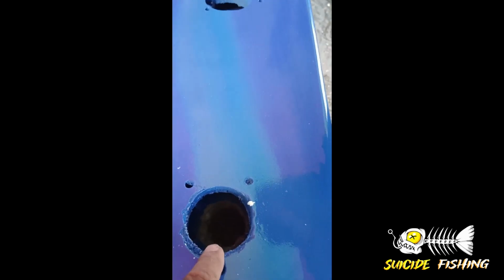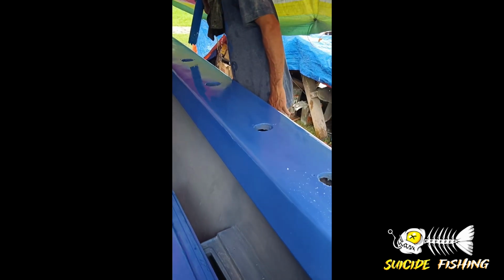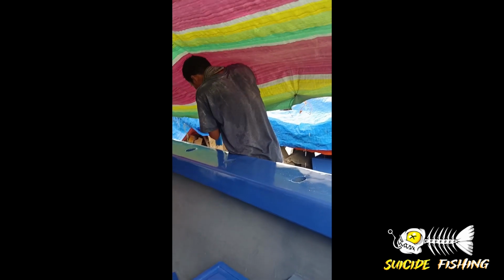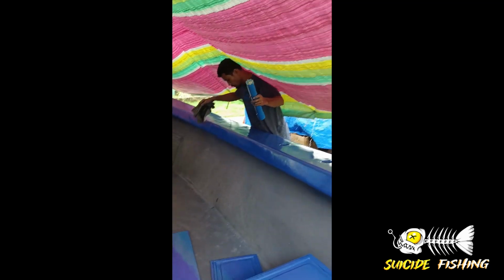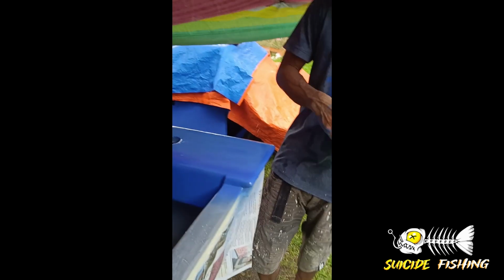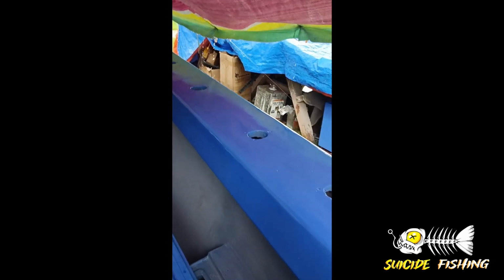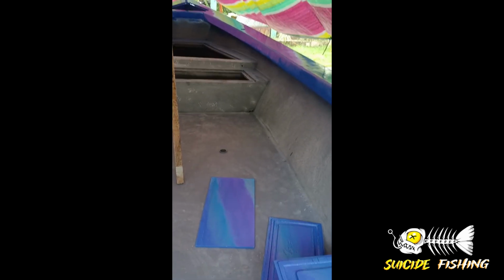This is a 15, and obviously you can see where it's going at an angle. Dennis is angling it at approximately 15. It won't be perfect, but what we can do is we can slide in the fishing rod holder. And what's going to happen is because it's round and tubular, like that PVC, it'll just trim off what's not needed. And then we take a blower and we'll just blow at a height about 6 inches above that, and it will blow out all of that powder and all that excess that we just don't need in there. And it will still maintain the integrity of having the expanding foam in there. It'll help keep this thing afloat if something dire happens.